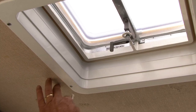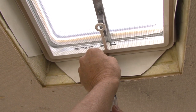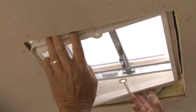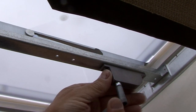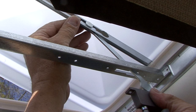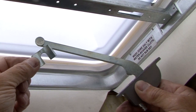Starting inside the RV, remove the trim ring from the vent. Remove the crank handle or knob by removing the screw that secures it. Remove the screen — it can be fastened by screws, clips, or tabs. Next, remove the screws that secure the crank mechanism to the vent frame bracket. Shift the crank mechanism front or back and move the lift arm up or down to remove it from the bracket on the lid. You can use the knob to move the lift arm up or down if needed. Remove the clip securing the lift arm to the lid brackets if equipped. The metal clips do not need to be reinstalled.